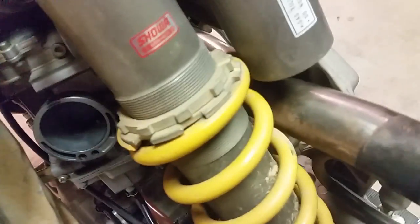Now you can see your carburetor, but you still have to do one more major step, which is take out this top bolt right there. Some people say you don't have to do that, but I don't see any other way, because it's a pretty tight fit to get that carburetor out of there. So I'm going to do that and then get back to you.